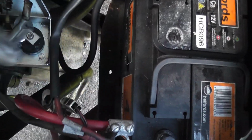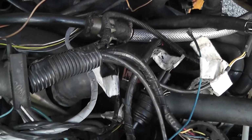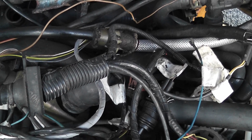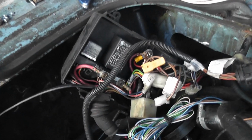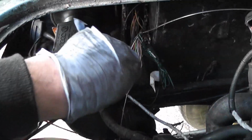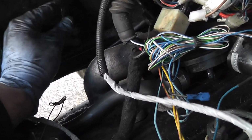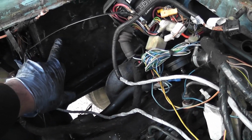But battery is in, battery connector is there, so there's a new positive wire going off down there. It'll be cable tied in place and everything. It's going down to the starting motor down below. The old starting motor used to be over there, so the wiring would have been no use to me. So that's why I had to put a new wire in. That junction box there is going to go here, and ECU is plugged in. We have our earthing point there, which is great. There's a convenient earth, and I will put the OBD port there as well.